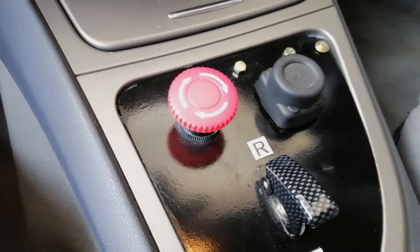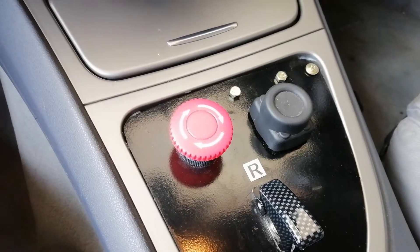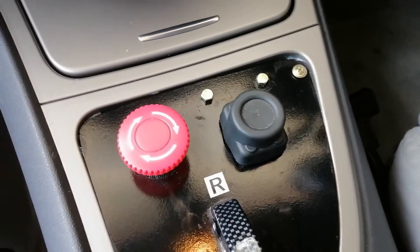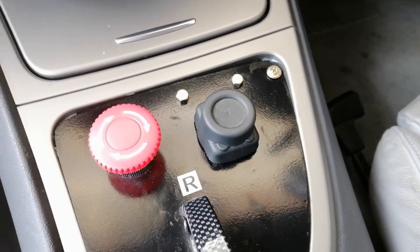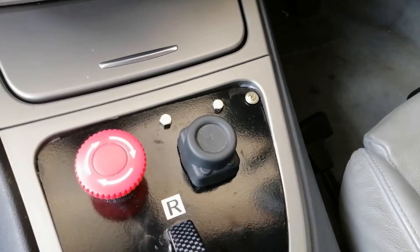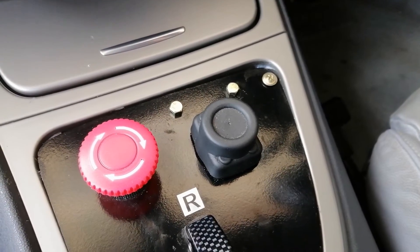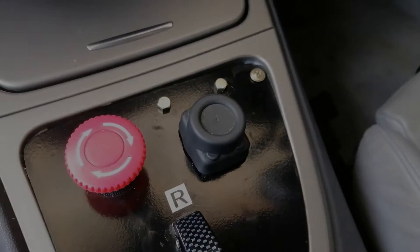This is the low voltage emergency off switch — it basically shuts down the traction circuit through the EVMS. This is the inertia switch, which is basically another government regulation — if you have a crash it'll also shut down the traction circuit to help if the batteries are going to electrocute someone.